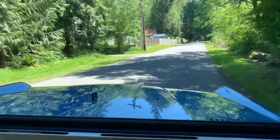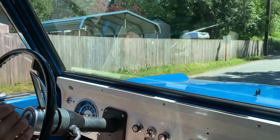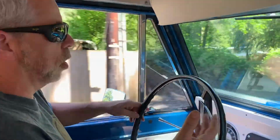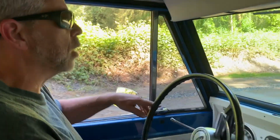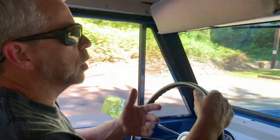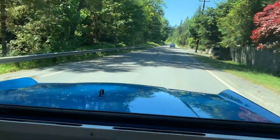But when this one came to us, it still had the stock original suspension in it, and the springs were a little soft. We ordered basically a whole suspension kit from Tom. So we had new shocks as well. So 4 shocks plus a steering stabilizer, front coils, rear leafs. We also did a 2-degree bushing in the front end. I like a little more caster, so it's just going to drive better on the highway. The tires are brand new, and they're a 235/75/15.